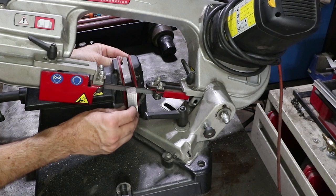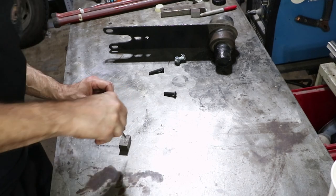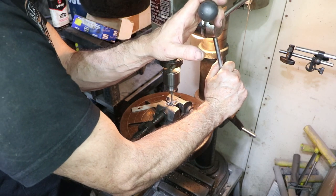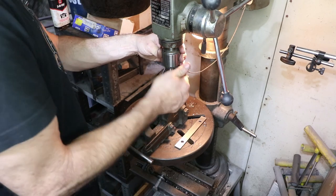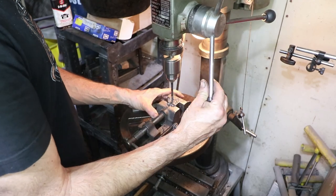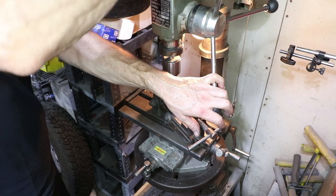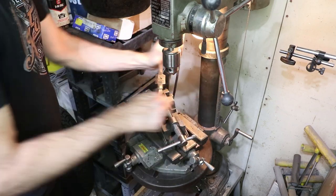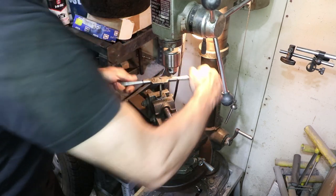The saw is so good these blocks don't even get hot. I'm moving the drill press by hand because I'm threading this with just hand pressure — just to get the tap started — and then I can do the rest with a wrench. Now that it's straight I can get a little more leverage. It's a pretty deep hole so you definitely want to start straight.